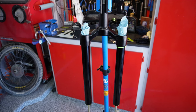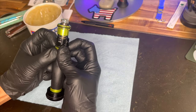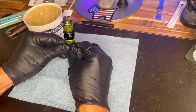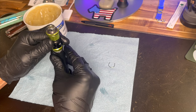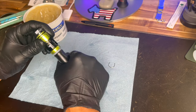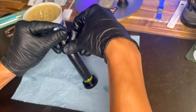Now we're done with the lower portion of the uppers. Before moving forward, I noticed my damper boot had collapsed inward — it's not recommended to run it that way. To fix it without full replacement, remove the clip from the top collar, slide the collar up, and pull downward to release the boot. Apply slick oleum all the way around the white retaining collar's perimeter, then carefully work the boot back into place — letting a little air seep in and working around the unit until it's symmetrical and fully inflated. Slide it back over the plastic piece, drop the green collar back down to secure it, reinstall the metal clip on top, and wipe down the whole assembly.